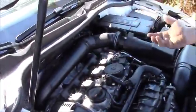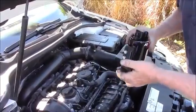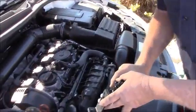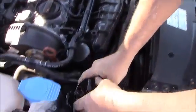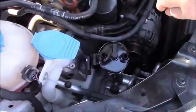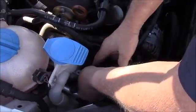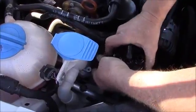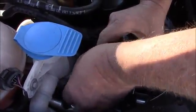So, first thing we do, we've already taken off the engine cover, pops right off. The can, we're going to mount the short L with the main bolt down. We're going to use the slot closest to the engine. We're going to put it about a ½ inch down from the top, seems to be about right for clearance. We're going to include a M6 nut and washer to mount this. We're going to be mounting it right on this exposed stud on the forward motor mount bolt.